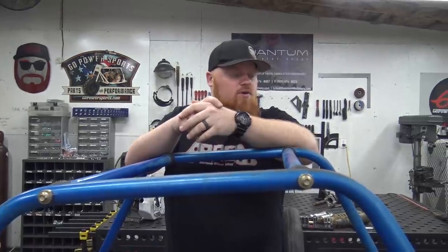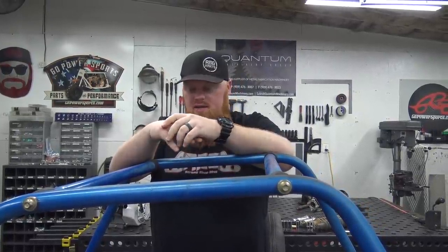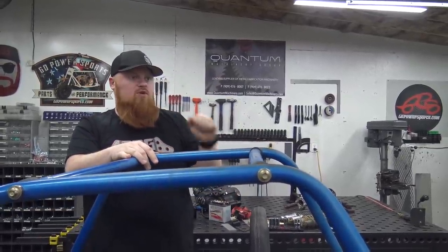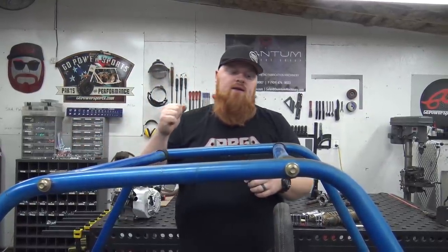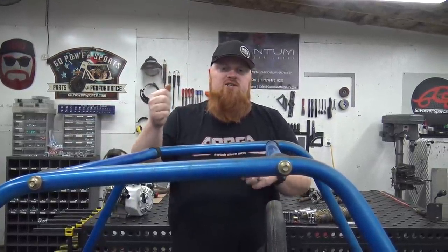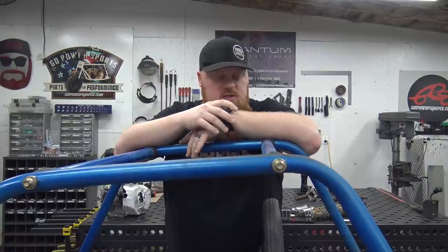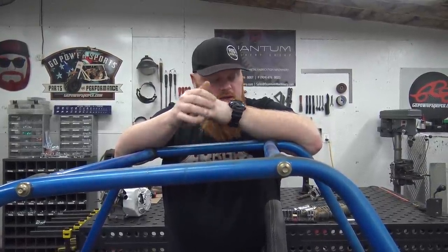On the next video you're going to see us make all the throttle cables, and I'm going to finish this wiring off camera — loom it all, make it look nice. We just got a hookup — I actually started it last night and she runs good. This four-wheeler engine, when you shift it, it doesn't want to, so you manually have to pull the shifter back into the stationary position it's supposed to be in. When you shift it you've got to kind of pull it back home. I'm guessing there's a spring or something in the transmission that's worn out, broke, or stretched — so I'll have to fix that too.